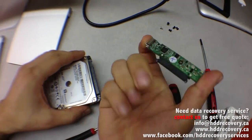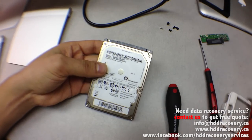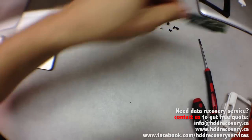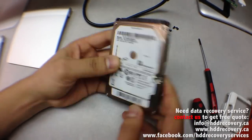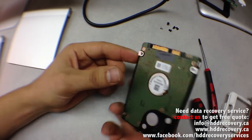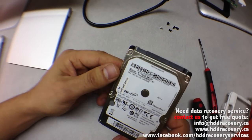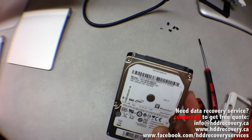That's the bridge we need to eliminate from the situation — we don't need it to test the drive and get access to the contents. There are no processors on here that perform hardware encryption, so we're not going to worry about that. This is not something like a Western Digital password hard drive. Now that we have the drive out of the enclosure, I have a USB caddy that we're just going to plug this into and see if we can get access to the drive.